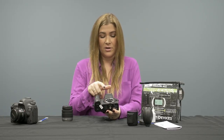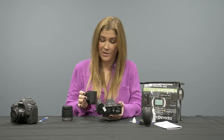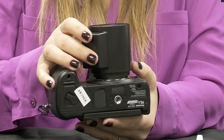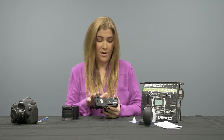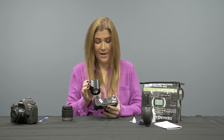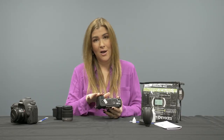The process is going to be the same with a mirrorless camera. The only major difference is that your sensor is much closer to the camera bezel, so you get a much easier view of your sensor, even with the naked eye. The sensor scope still helps by magnifying and illuminating the sensor surface, and it fits right on the camera bezel just like your Canon or Nikon. Because the sensor is closer, it's going to look different than a digital SLR — it almost looks a little blurry at first, so you need to adjust your eye. In this case, I see a few specks, so I would use the exact same process I just showed you.